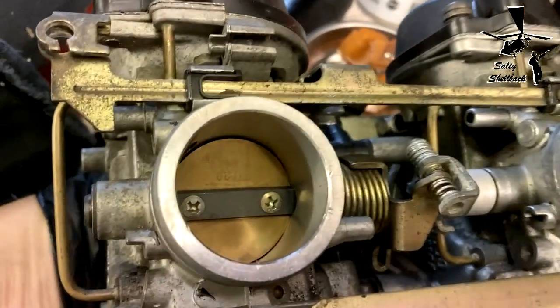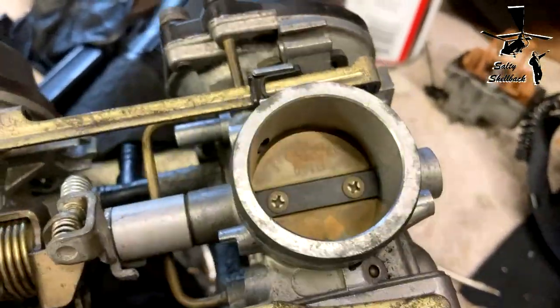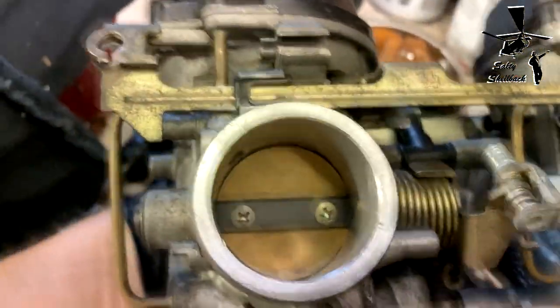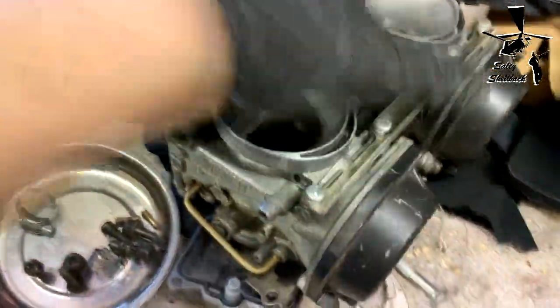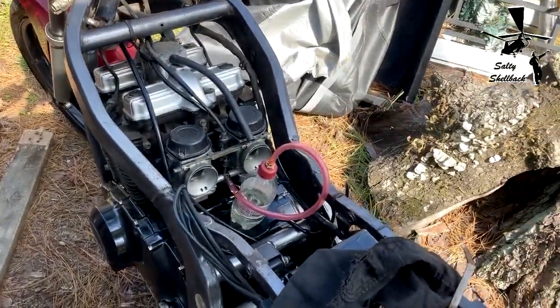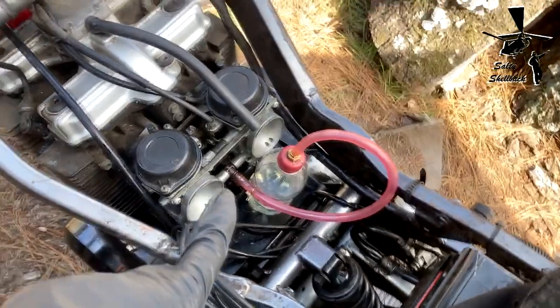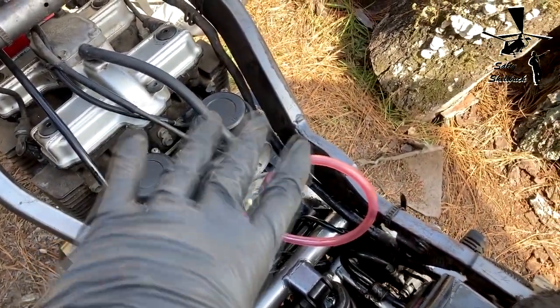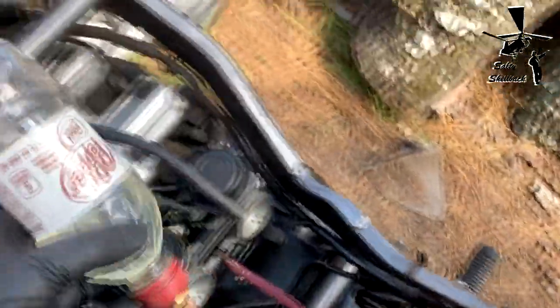You can see a big gap there — this gap looks smaller than this gap. But other than that they look good. Something weird is going on in that I cleaned the carbs, made sure everything was functioning properly, bench synced them, and then hooked up my IV bottle.